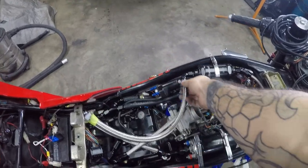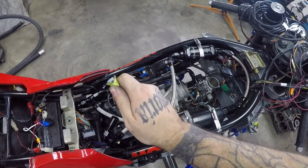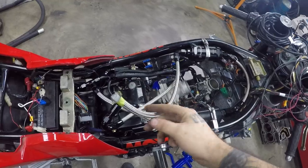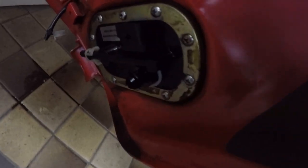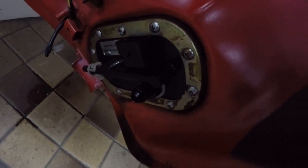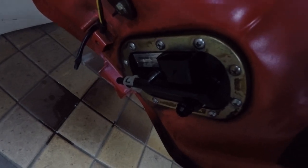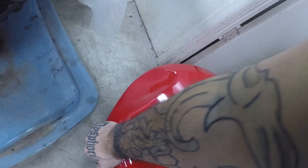Hose fittings. Oh, a couple of hoses made. I guess the layout is I need one more AN6. Probably looking at like a 45 degree or something. Need to cut this a bit shorter. That'll go to the underside of the tank there, so you can see that one there. The bulkhead fitting is actually the feed. The one down there, the OEM feed, is now the fuel return, so just need one more PTFE fitting to